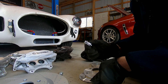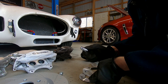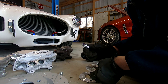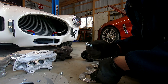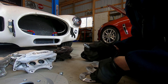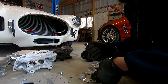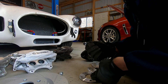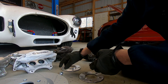If you're running a thicker spacer, always get something that's hub centric. I always run ET lug nuts — extended thread lug nuts. The clamping force is much stronger; you get about 50% extra thread contact with your average ET lug nut. Don't buy a cheap eBay one — go with Summit Racing or a quality manufacturer that makes high strength ET lug nuts.